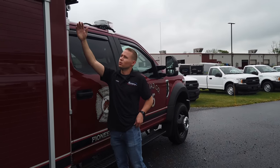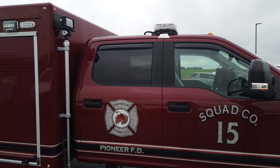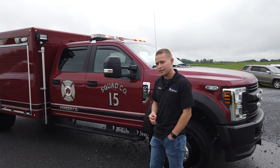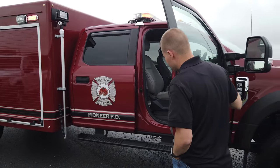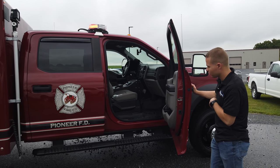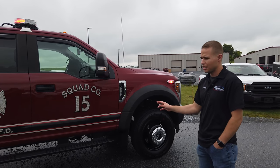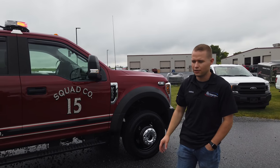Traveling up along the side, we have the Whelan Pioneer pole lights — Pioneer Plus series — a very nice light that is all 12 volts. Everything on the truck is 12 volts. With the Carbide package tied into the OBD2 port, we can do nice customizations with different functions: when you open the doors, we can sequence off certain lighting. If it would be blinding, we can temporarily disable a few modules in the light bar. We also illuminate the entire running board, and there is underbody lighting at 10 spots all throughout the truck, creating a halo close to the truck at night and cascading light further out for a safe working environment.